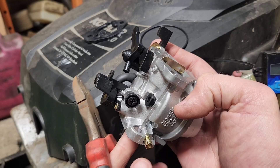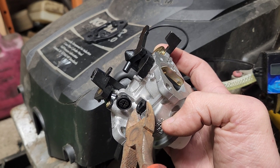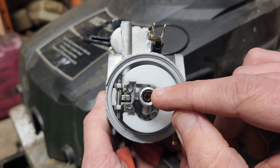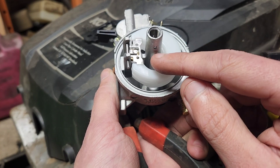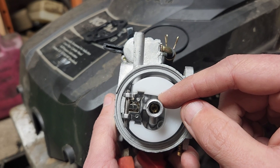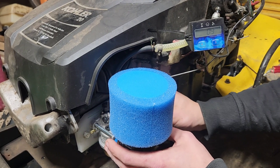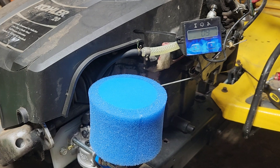Just in case anybody is unfamiliar with jets on these carbs: this is your idle jet, and all you do is take a pair of cutters, put it like this and pry, and it'll pop up — then you press in whatever you want for an idle jet. On the underside, this is your main jet, and you just unscrew it with a flathead screwdriver. There is a venturi tube down inside here, but we are not changing that out. These carbs are capable of running the stock tube clear up through into methanol, so there is no need to ever touch that. We'll get this thrown back on the machine — 0.024 idle jet, 45 primary jet. Let's see if we can get it started.